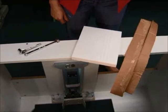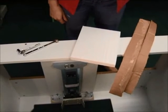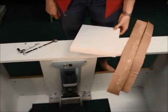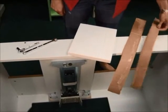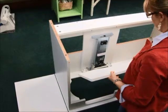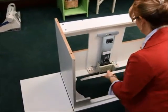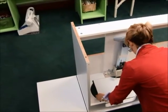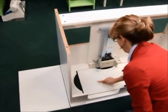The following instructions will help you level the platform P. You will need the styrofoam from the box, a sheet of cardboard from the box, a 10mm wrench, and adjustable socket wrench. Install platform P into the opening of your cabinet, making sure the pre-drilled holes are facing you.